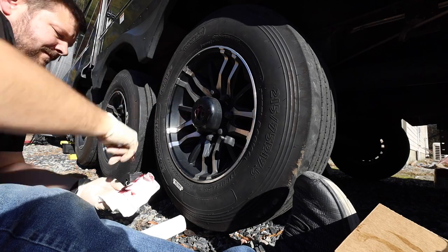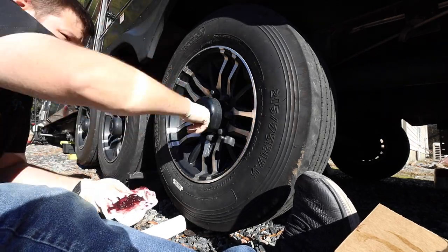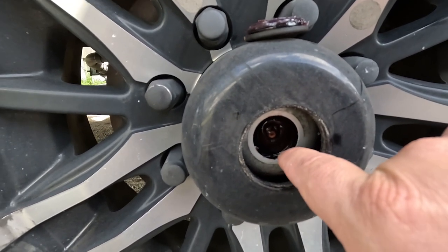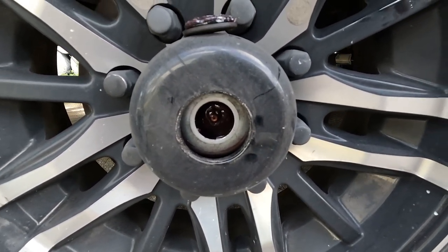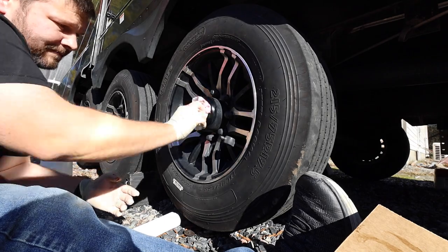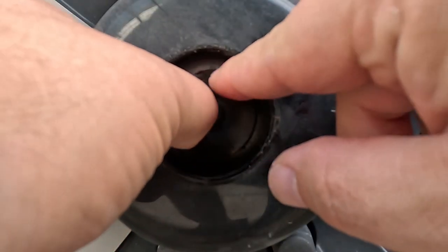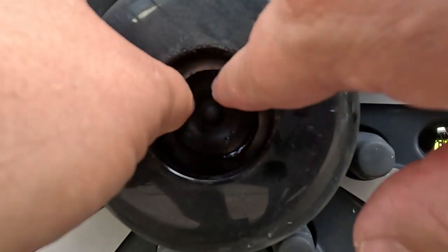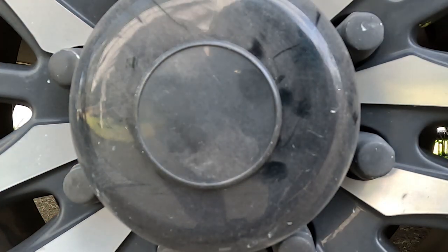Just press it on and it gets stuck to it. Start pumping while he rotates the tire, and you do that until the entire new tube is in there. As you're pumping grease into that little nozzle, the grease goes in and pushes all of the old grease out. What you're going to see is all of this area is going to start to fill up with old grease and start oozing out — which is why I said this thing is so messy. It fills up in this center cap, it fills up in this little hub. Also, word of advice: be careful, if you put your finger in here don't rub it against this little metal edge because it's sharp — it cut my glove a couple of times. But that is really it. Once you're done, you're going to clean all that grease out, replace the little rubber cover, and pop your cap back on. Make sure it's good and clean before you do that.